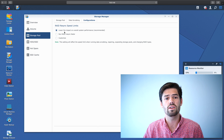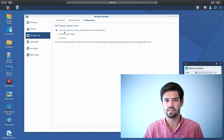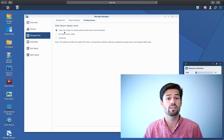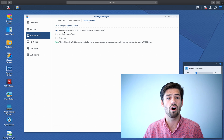One thing I forgot to mention: I would highly recommend writing a bunch of dummy data to the drive first. There are scripts that already do this. Basically, what this does is stress the drive initially, meaning that if it's going to be one of those drives that fails in the first 10 hours, you'll find that out very quickly. Hard drive failure happens with a reverse bell curve — the most probable time a drive is going to fail is either in the first few days, and then it's not likely to fail for years. By stressing the drive early on, you can detect any of those early failures. Always make sure you have a backup, and remember RAID in itself is not a backup.